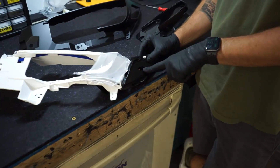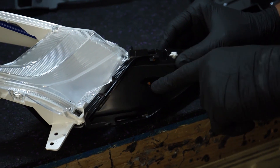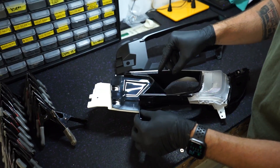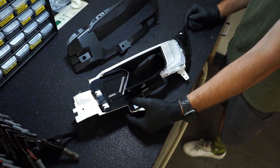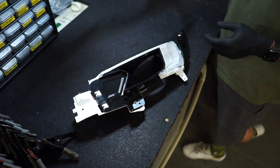There's no bulb for the amber marker — it's an amber LED, so that's not changeable either. Since we're blacking these out, we simply unplug it. Ichiko does a great job assembling their headlights in a logical way: two tabs snap in, there's a larger screw hole mounting to the front lens, and then it screws in at the corner.